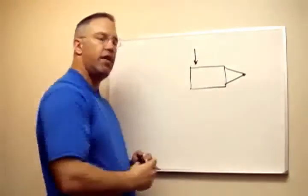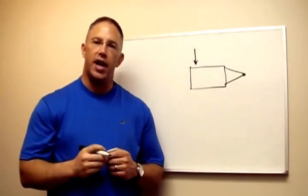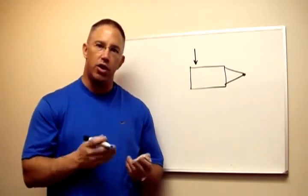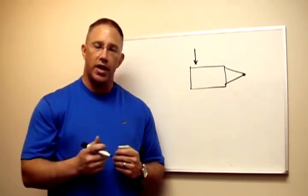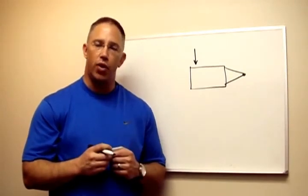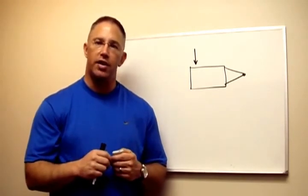When a trailer is acted upon by an outside force, it attempts to move that trailer side to side on the hitch ball. By moving that trailer side to side, it applies a load to that hitch ball that is acting behind the rear axle on your tow vehicle. That side to side load or side to side movement on the ball applies a steering torque into your tow vehicle and causes you to have to steer the tow vehicle in an attempt to control it.